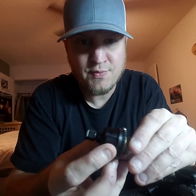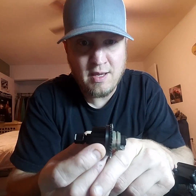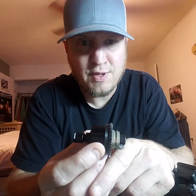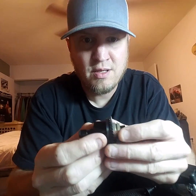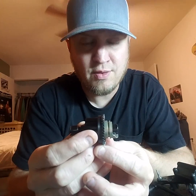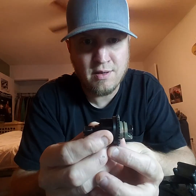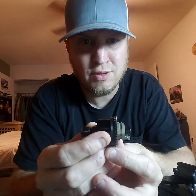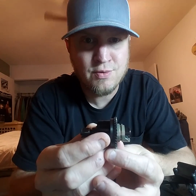Here's the rear diff I'm working on. Here's the side of the ring gear, and what you want to do is put the shims on this side behind the bearing, moving the ring gear closer or tighter into the pinion, making the mesh good and tight. You want a little bit of backlash but not very much.